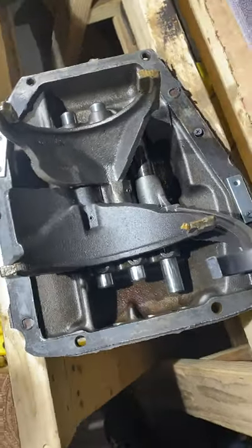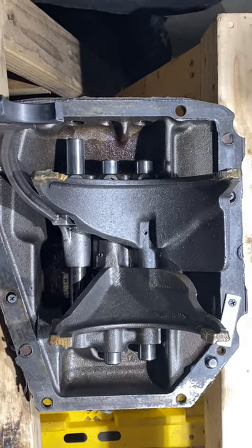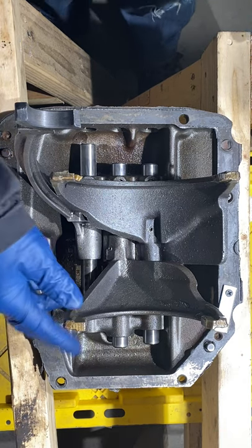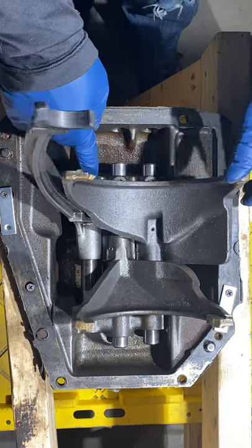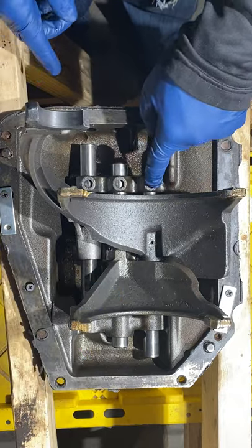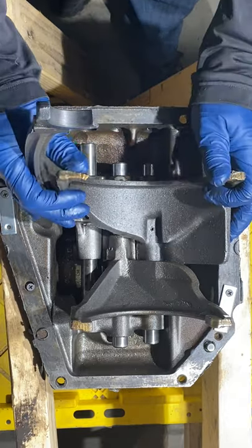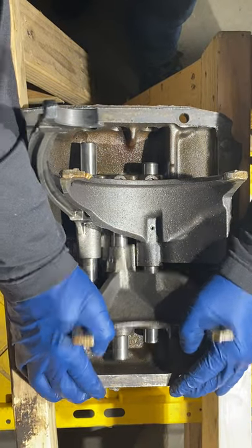I'll give you a little bit of an explanation of what I found with this. I am no expert. I'm definitely a stone cold beginner. I'll say to you without any equivocation, I am not a mechanic. This works: there's two ball bearings here, two ball bearings here. Underneath each one of these is a detent system. What I mean by detent is there's a spring and a ball bearing pushing up, and it sits in a certain cut in the bottom of that, which allows it to shift back and forth. A lot of the reasons why these freeze up is the springs break and stuff.